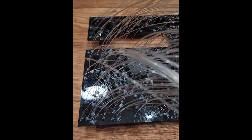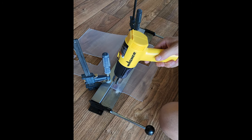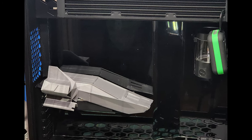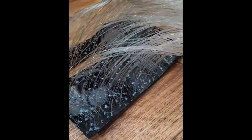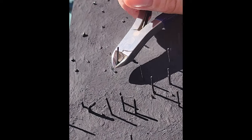I can only imagine how difficult it would be to work with fiber optics. Can you tell me about the process of how you went about hiding all the hardware? The fiber optics was the most difficult part of the build. There's almost 400 fiber optic wires that make up that background. I cut a piece of quarter-inch thick acrylic, heated and bent it to hug around the motherboard and water cooling parts. I hand drilled almost 400 holes along that piece of acrylic, threaded through all those wires, put a little glue around each one — turns out hot glue melts fiber optics. Glue choice and learning from that as I went was difficult. Painting it all and cutting them flush so the light would come through, the routing took several attempts.